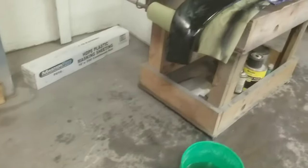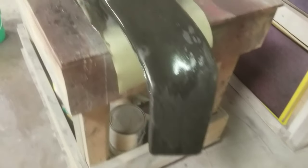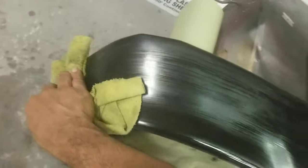Because of that, I saw tiger stripes in this part. Another thing that annoyed me as a paint and body professional — this stuff just did not set up right. It feels tacky and it's been two days, and that's because there's no hardener used.